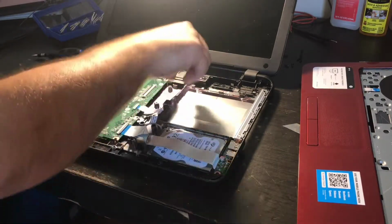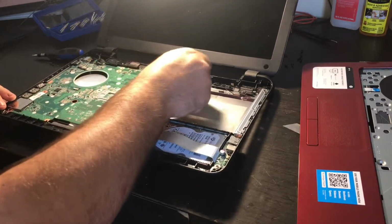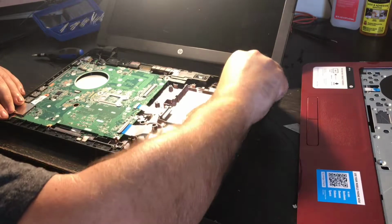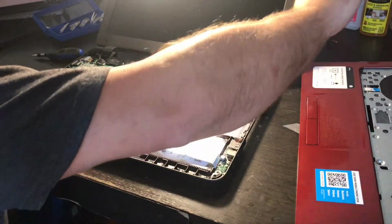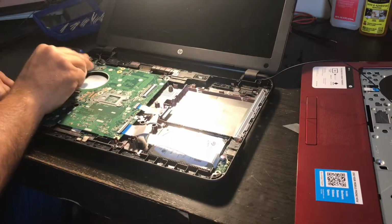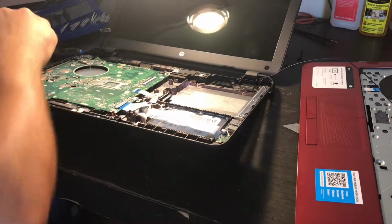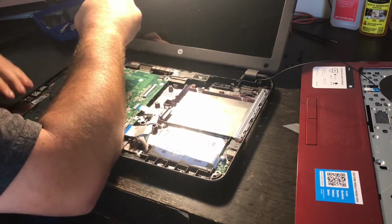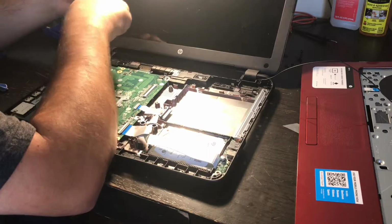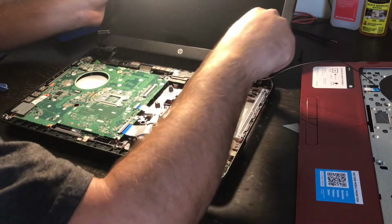Okay, inside of a monitor, usually these days you will have the antenna to the Wi-Fi. I have already disconnected the Wi-Fi from underneath on that card that I took out, the little Wi-Fi card. See that right there? And then right here, I'm disconnecting the monitor from the motherboard, from the display. So now I have to unhook the hinges. Looks like there's one screw here for the hinge. And again, every computer is a little different.